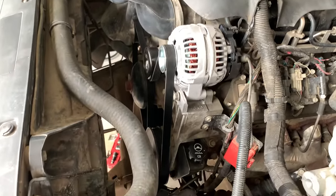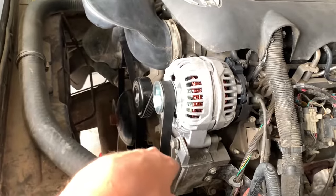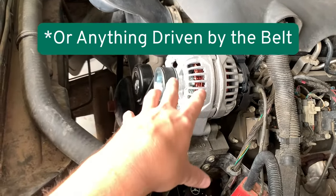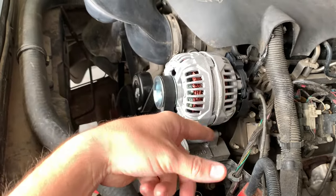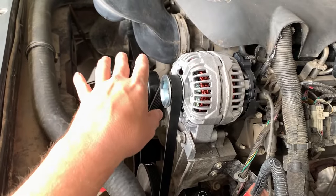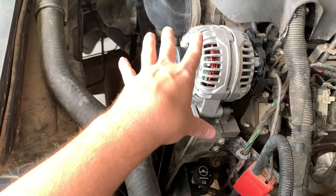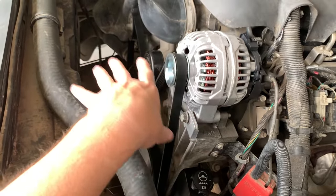To check and see if this alternator or this whine that I'm hearing in this vehicle is related to bearings. This truck's been sitting overnight. I'm actually going to take the serpentine belt off, turn it on, and let it run for not any more than 30 seconds. And I'm going to hear if that whine is not present, to make sure it's not related to something else.